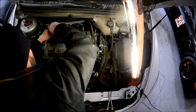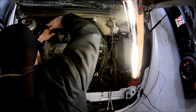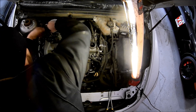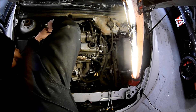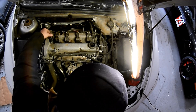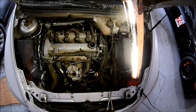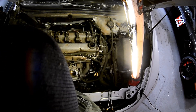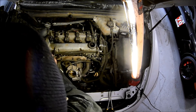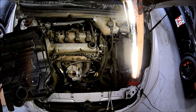That's pretty much all she wrote. This is not a very hard fix, but if you do get that P0013 or P0014 code, which is pretty common on these engines, it's pretty easy to fix. That big plastic piece you saw me pull off is the entire air intake — the whole thing. Don't forget to reconnect that connector to that cam sensor.